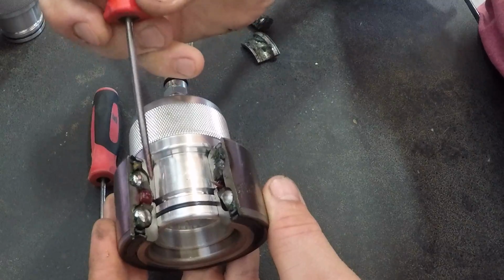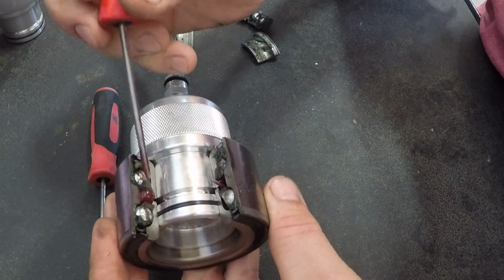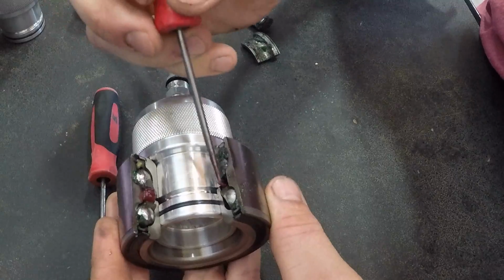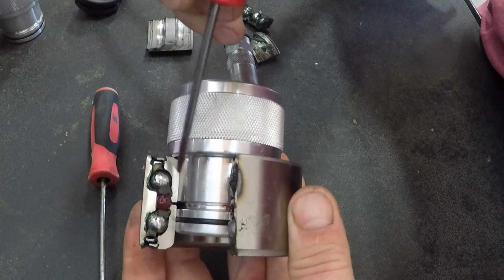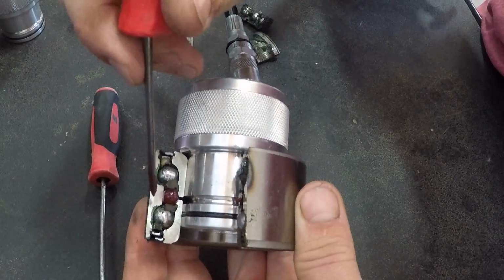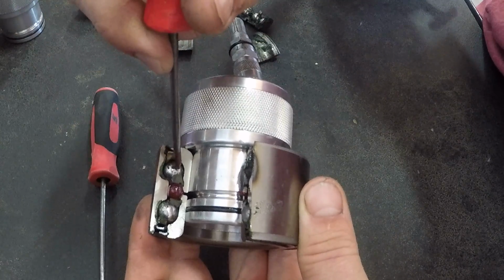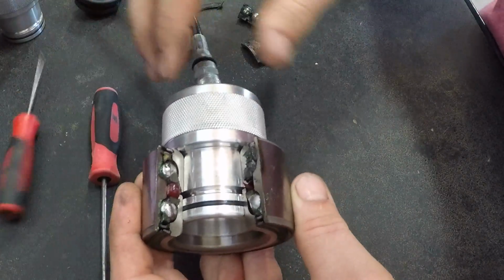in the bearing here, and then once this is full of grease and it can't go anywhere, it actually forces the grease past the ball bearings and comes out the seals, because as you can see there, the grease is in the center cavity. So there's no way for grease to get to the seals except with passing by the ball bearings themselves. So there's that.